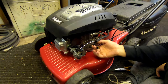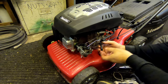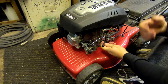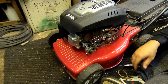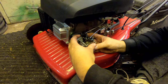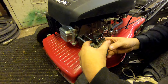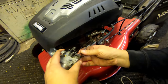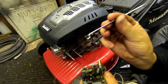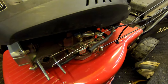I scrapped the mole grips — they weren't doing what they were supposed to be doing, so I emptied the tank. I didn't show that because there's no point — everybody knows how to empty a tank. Straight back onto it: removing the carb. Just a little tug on it, like that, it twists up like that. You've got to get this shoe bracket, or you can just pull it all out in one — that is your choke. Do not lose that.